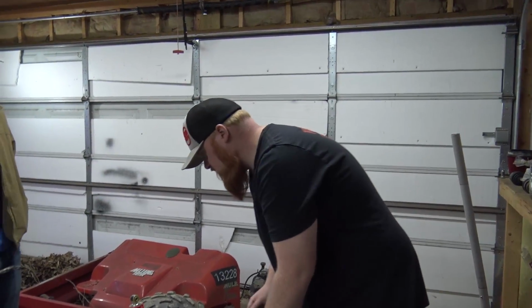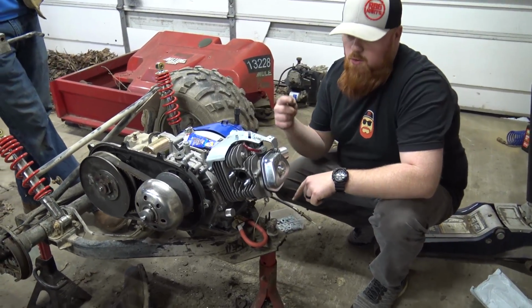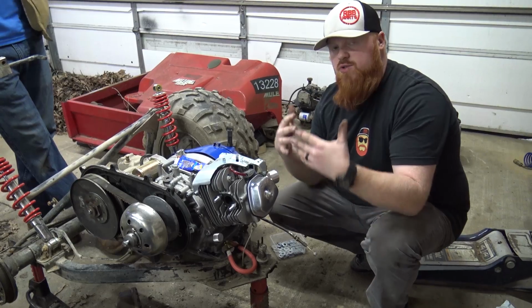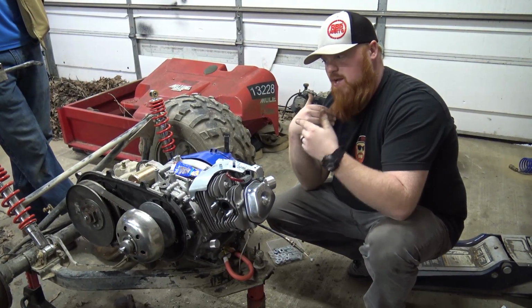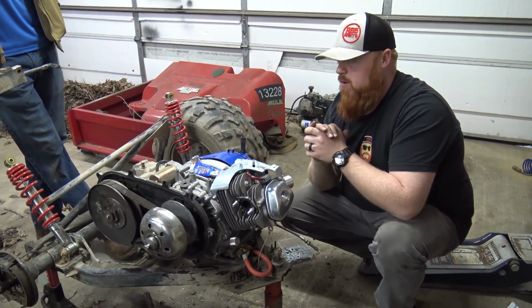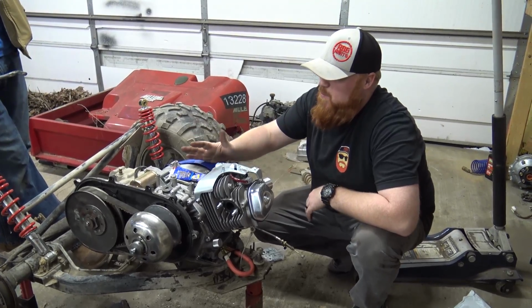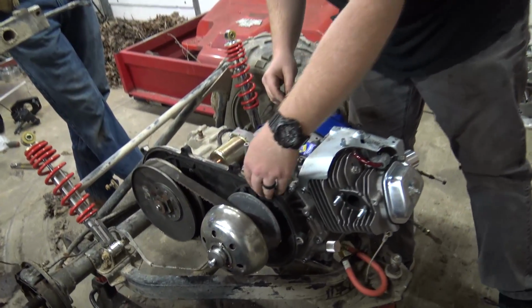Done. Alright, to get this mammoth jamma on there, we basically had to drill the front holes forward about 1/2 inch probably, and then we had to drill all the holes wider, spaced out this way, because the stock engine must have been narrower. So we got the torque converter cover to line up. We had to re-drill the front holes in it.